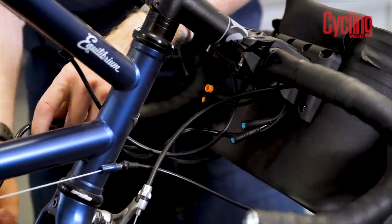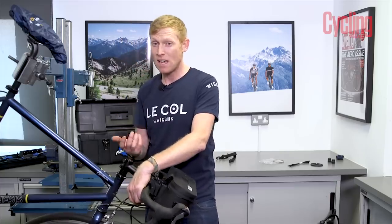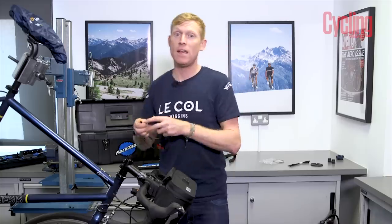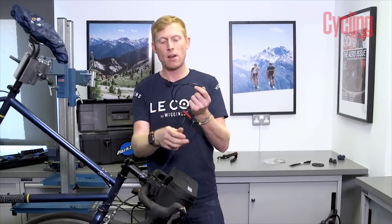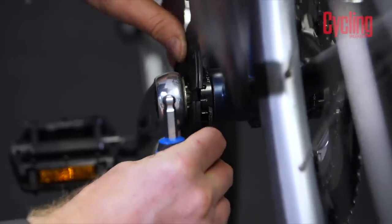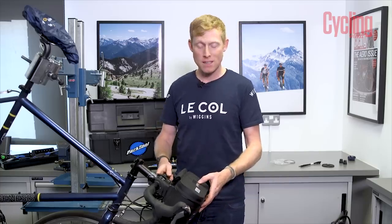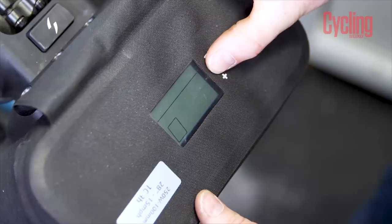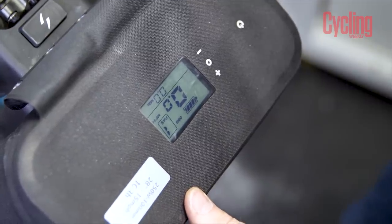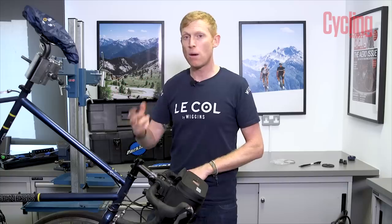There are also some orange and some blue sockets. The blue ones are for a brake sensor that you can potentially get, though it doesn't come in the kit. The orange cable goes with the magnet that goes around the cranks — that connects into the orange plug here. To turn the system on, press the on button and then hold the circle display button, and the whole screen comes on. The plus or minus cycles through the power levels. Then we need to connect the magnets that go around the crank, which will determine when the motor works.